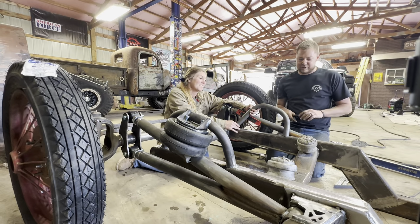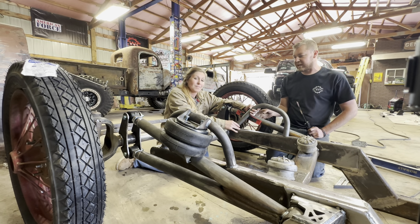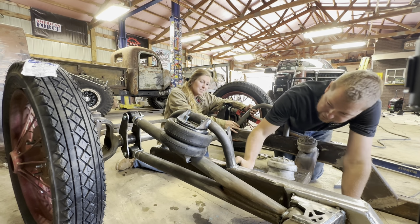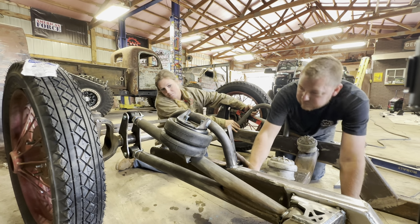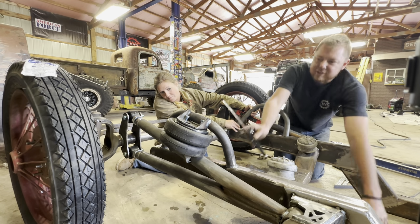This is how we're going to mirror image this thing. I got an angle finder. Hannah's got a level zip tied to the control arm, which is the same distance on that side. So that's her job. So we're going to take this angle finder, find our angle of this strut tower. That looked pretty good. Shade off. Right there? Yeah. All right, so there is our angle.